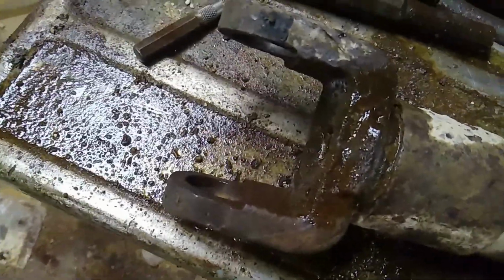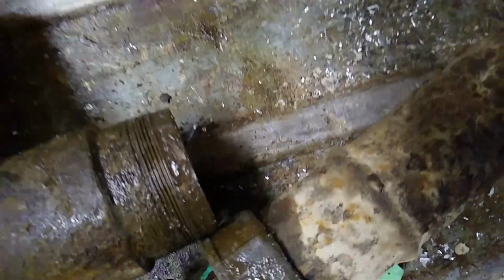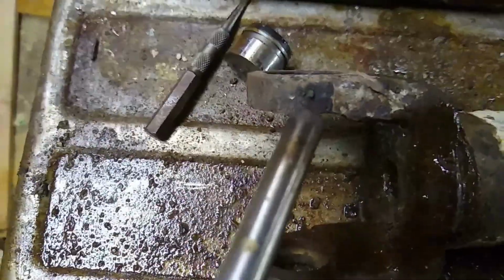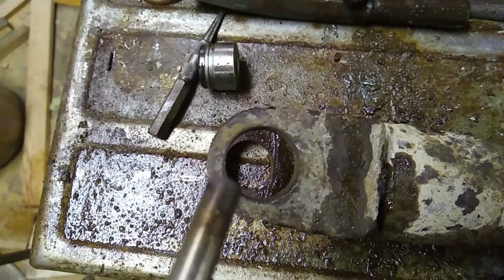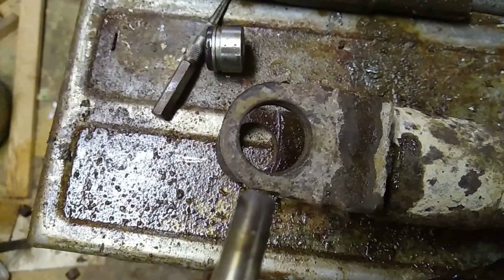And I'm not going to go over how to replace the U-joint that I have for it, but I will give you one little tip. You have to take a torch and heat up all the way around here, because from the factory these are set in place with plastic, and once you heat that up enough, you'll see the plastic come out.